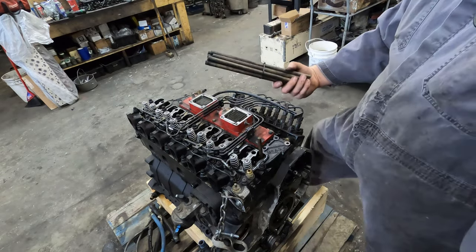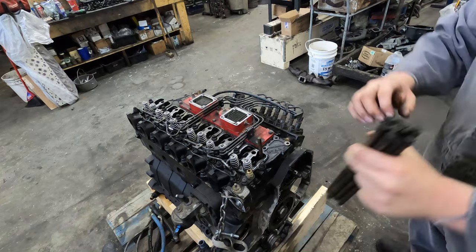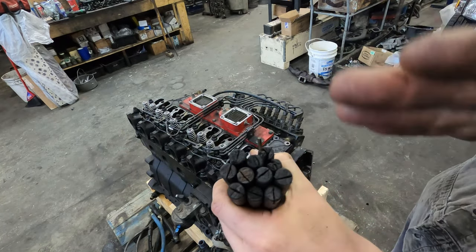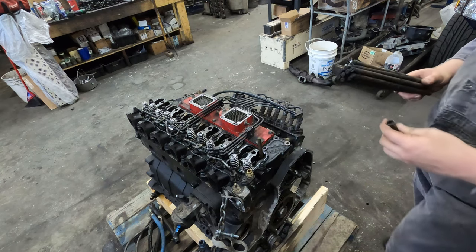It's just half inch wooden dowel. You don't want hard wood myself, but if you see how there's a little slit in the end of them here? So I just took a hacksaw and put a little slit in them. And it doesn't have to go that far down. You can see maybe half an inch down or something.